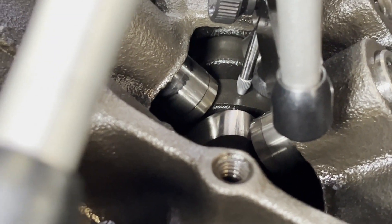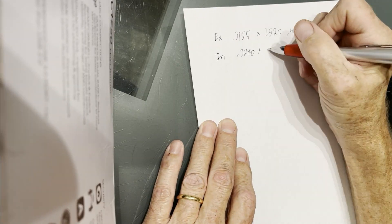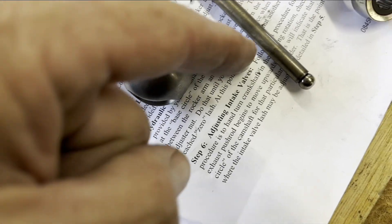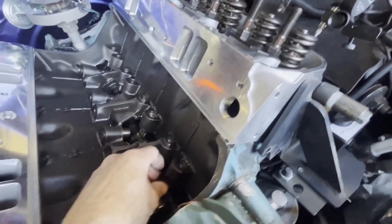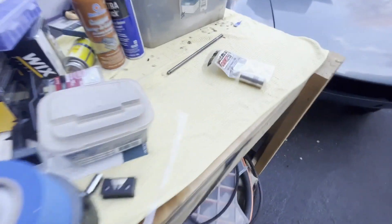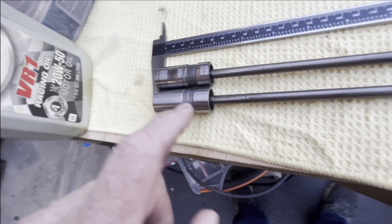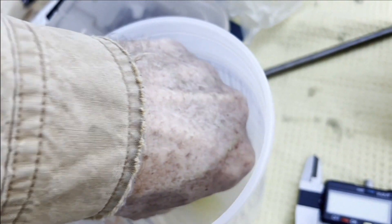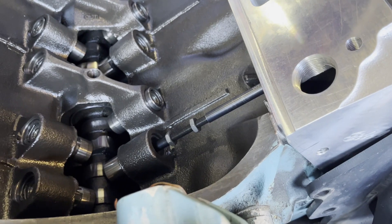I have no idea what this cam spec is. We'll check the exhaust first and then the intake. I'm using the Vice Grip Garage method of determining push rod length — there's a link in the description. This washer has about the same arc as the casting. I've got my level line from the center of the washer to the center of the roller. I'm going to remove this hydraulic lifter and replace it with a solid I picked up for $15 from Comp Cams. You can see the solid is a little bit further down the hole, which makes sense because the hydraulic lifter will be pushed down slightly with the preload.